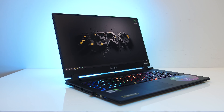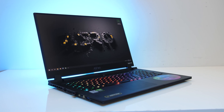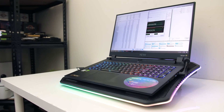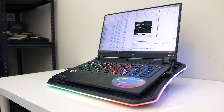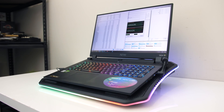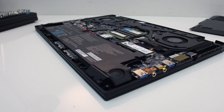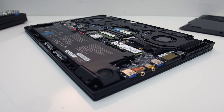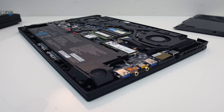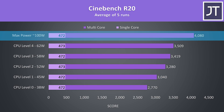Sure it was thermal throttling on the CPU in these worst case workloads, however I prefer this compared to the thermal cap being say 100 degrees like with the Dell G5. Simply by boosting the fan speeds it was possible to hit some nice performance numbers, and adding a cooling pad helped too due to the large mesh area on the bottom. Given we can boost the power limit up to whatever we want, the limitation is going to be thermals, and I think it's great we have this level of flexibility. Considering we could gain so much extra performance by boosting the power limit with XTU, it would have been great if Gigabyte tapped into this more with their control center software rather than maxing out at 62 watts — in CPU heavy loads that's just leaving performance on the table.